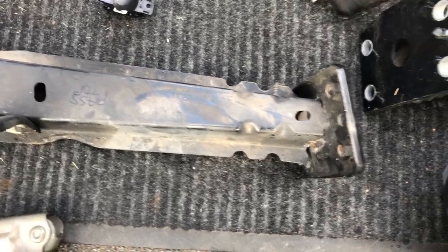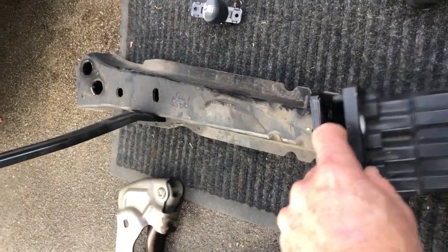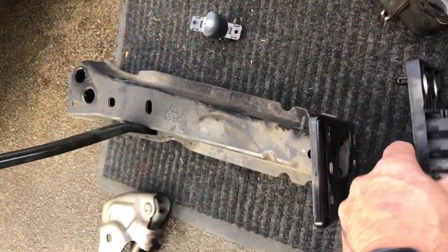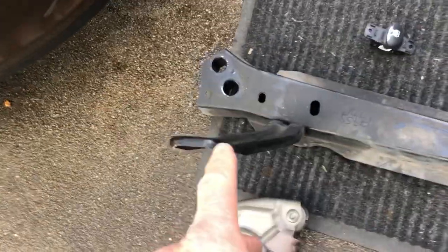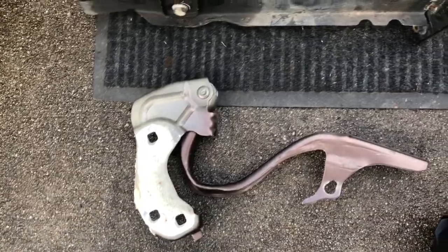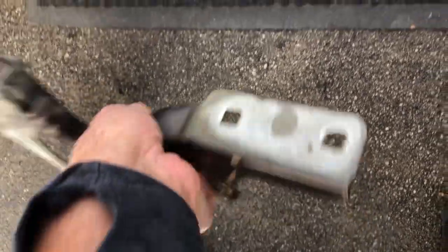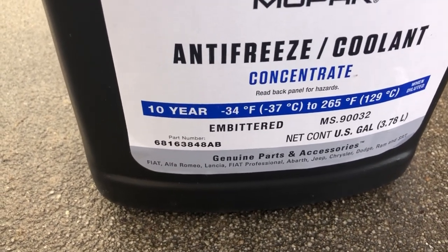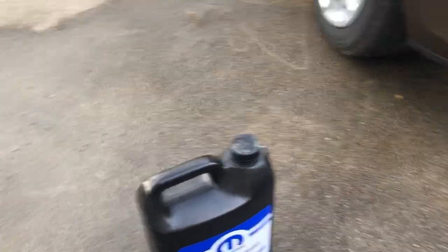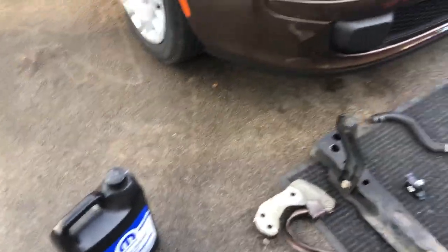You can see I replaced this lower beam — it's got two bolts that tie it in, and four bolts that tie it in here. I had to replace that because the other one got sheared off. I also replaced these top rail supports, and there's your hood support with the prop rod. The bottom of the hood assembly just got bent a little bit, so I got replacement brackets from a donor car. This is the coolant I use — it's what most Fiats take. This is the concentrate, only a few dollars more than the 50/50 mix. You'll use about a half gallon plus a half gallon of water for a refresh.